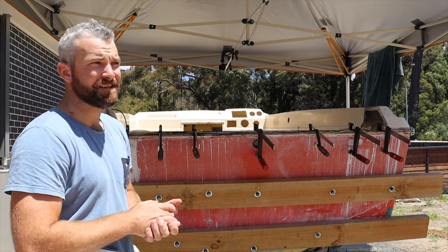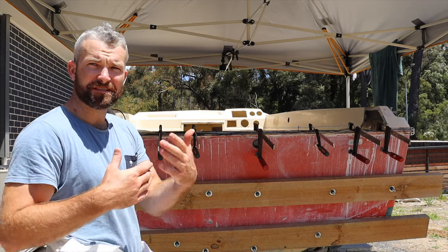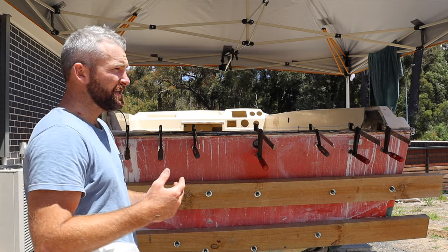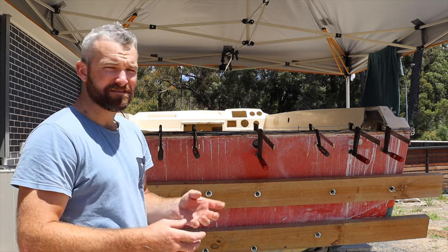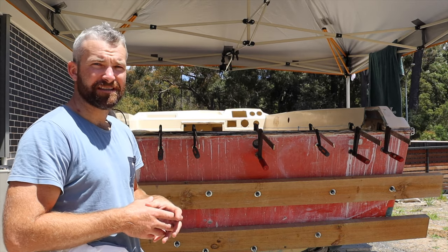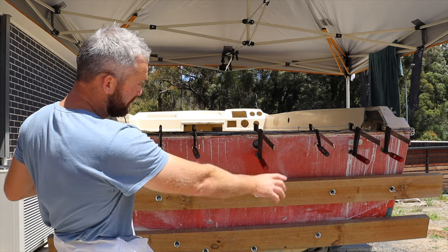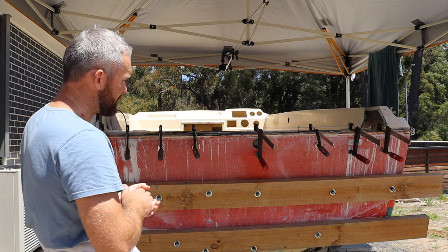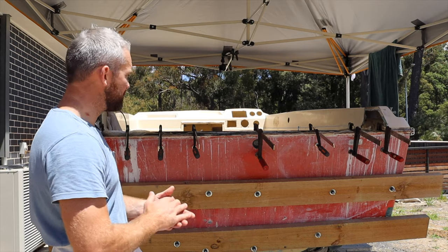Normally what would happen is you'd laminate a couple of sheets of thermalite in there, because generally speaking, when you do a transom, the transom will be rotten. However, this being a fiberglass construction transom, which was done in 2005, I really only wanted to beef it up more. So that fiberglass there held a pod, which you guys would have seen in the earlier videos of the boat. And that pod swinging 200 off the back would be causing a lot of leverage.